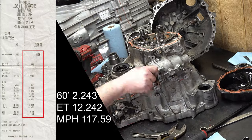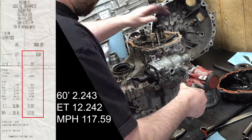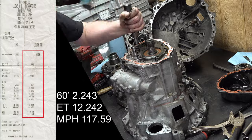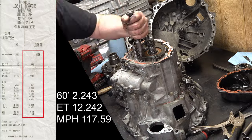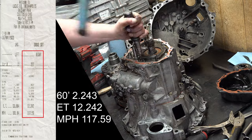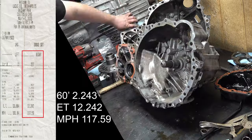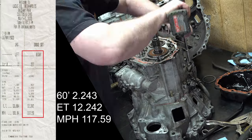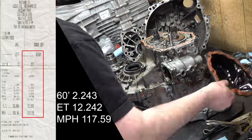When I first put the 2GR together back in 2008, back then we were making 275 wheel horsepower. The redline wasn't even elevated — it was redlining at 6500 RPM — and even that car did a 13 flat with a 1.7 60-foot time. This thing here did a 60-foot that was significantly worse despite having way more power, and that's just because the gearing was absolutely awful. So this transmission here is going to fix that.